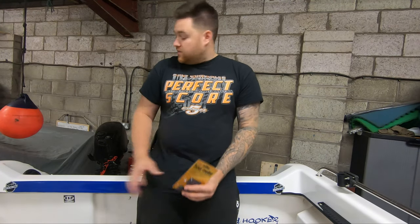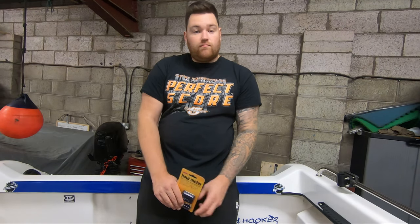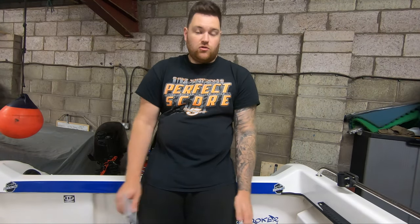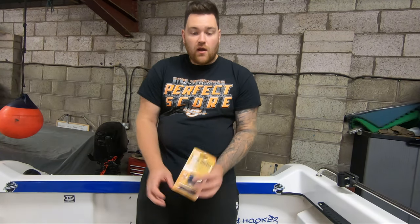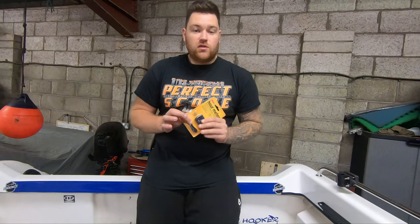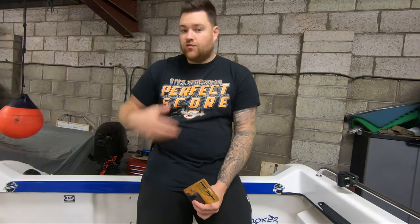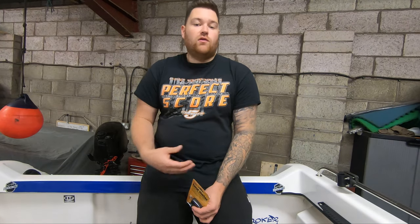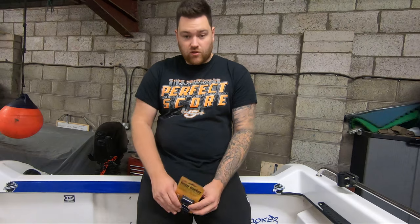The other benefit of this is the 5 horsepower drone motor that I'm using. That's no EFI, it's completely carb. There's actually no electronics on it at all, everything's manual. This works in exactly the same way. It goes round a single spark plug cable and counts the hours that you're running your engine. Like I say, it's just for me personally, so I know in 50 or 100 hours time, or whenever I want to service my engine, that's how many hours I've done.